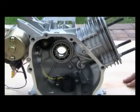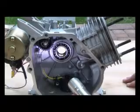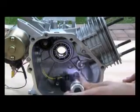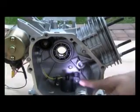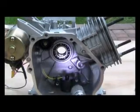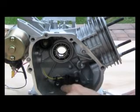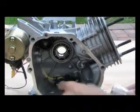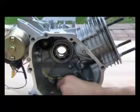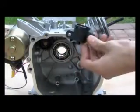The first thing you want to do is remove the governor arm assembly. As you can see, the governor arm is up here and you have the low oil sensor right here. You want to remove both of these because you do not need them. To remove this, take an 8mm socket wrench and unscrew the screws here, then this comes right out — this is your low oil sensor, you don't need it.